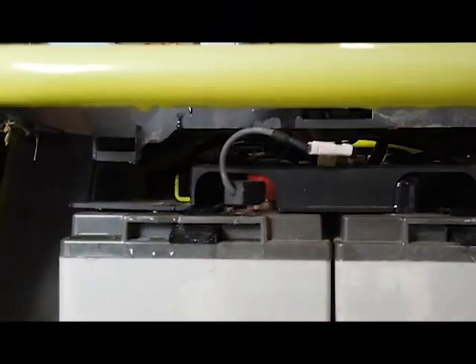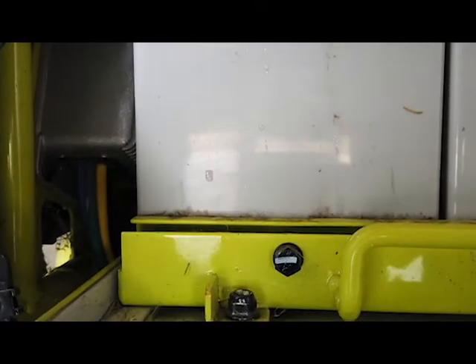Now you're going to see the batteries exposed here, but down here it's 13mm. You need one additional tool I didn't point out, which is a 13mm box wrench — open end is going to be better because it goes underneath. We're going to take out these two next: 13mm here and 13mm down below. There's a washer in between there — you need to put that washer back.